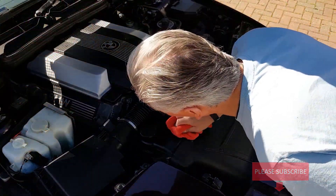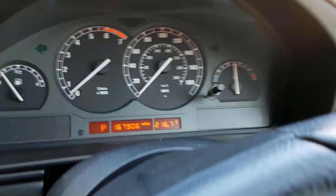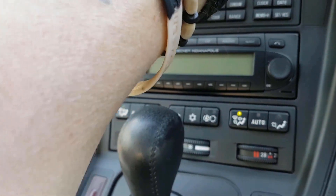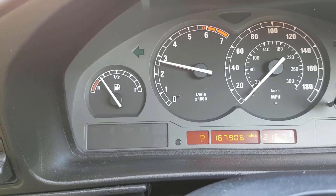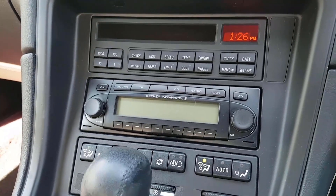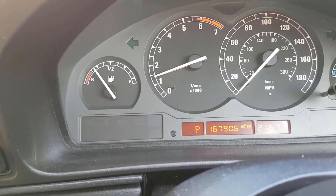I'll pop in the car with the engine running. The gauge is right in the middle as we'd expect. Check the air from the vents — it should be boiling hot as the heater system is working. If you're getting no heat at all, rev the engine up a bit to get it going, but there shouldn't be any need. It is boiling hot in there. The gauge is in the middle — that's what you expect on a hot day with the heater on.